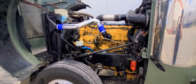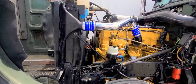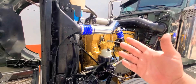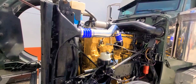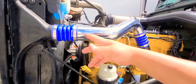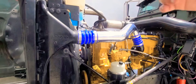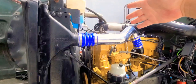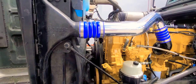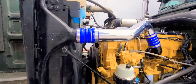This wasn't a planned video — it was just something I came to do and I thought I was gonna be able to do it a lot quicker than I thought, but it took a little longer. Why not do a video on it? It might help somebody out having the same issue. Pretty much: you've got to move the fan clutch out of the way, take out your fan, take off your AC compressor and alternator belts, loosen up the fan clutch, take out your bolts, clean it up, silicone on them, and boom — put it back together.